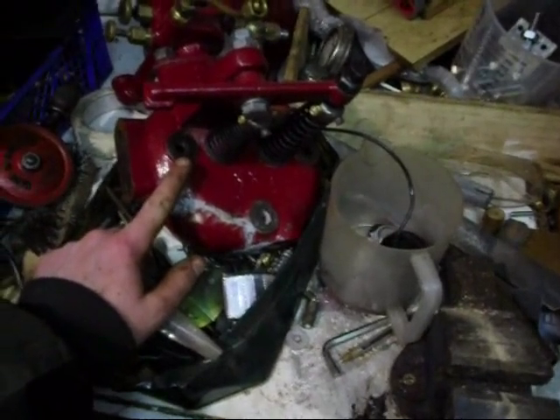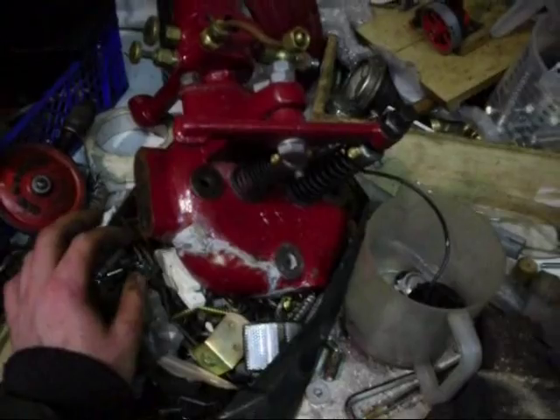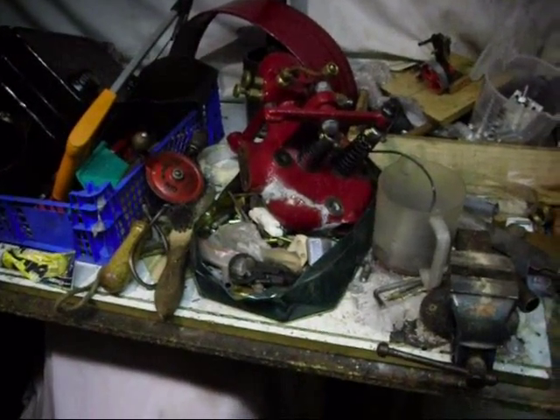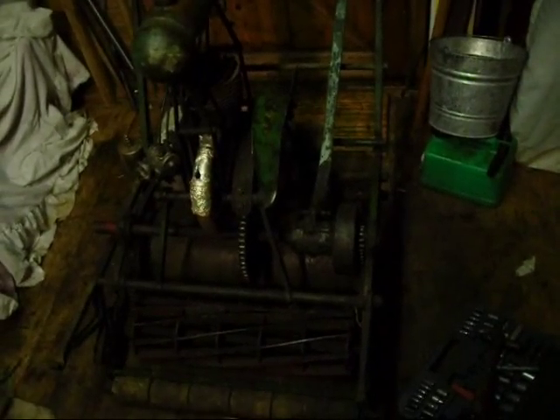As for other projects — I've got the Amanco head here still, just waiting on some new cylinder head studs I ordered, which are 7/16th Whitworth, interchangeable with the American size that they are. So we'll be able to fit those. I've also got all the governor bits to do still on that engine. I've got the cream separator down there to do — I've now got some timber stored up here and another bit over there which I'm going to use to make the frame. That gearbox there I'm not going to use, basically because I can't get the crank bit off the side of it, so I might use that to make a mechanical hacksaw.